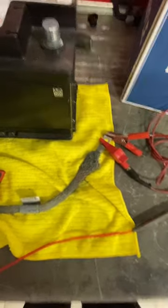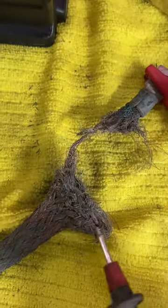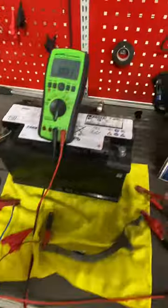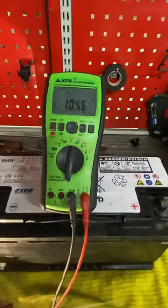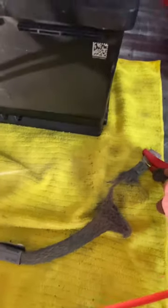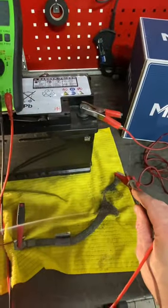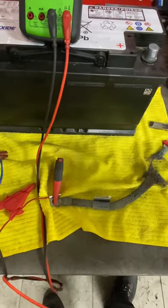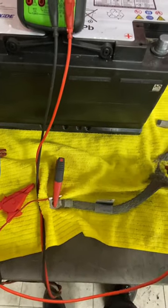As you can see, there's literally nothing left of that wire now - it's like three or four strands, it's hardly even connected. Let's check that out - it's going to be dead interesting. The bulb's still crazy bright, but what's the voltage drop now? Let's go to the end of the cable - there's a massive voltage drop, look: 10.3 volts. And at the front of the cable we've got 12.23 volts. So if this was in a vehicle, you can imagine what would happen with a bad wire - it could literally just be hanging on like that.